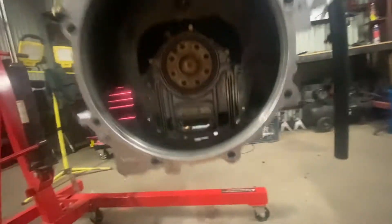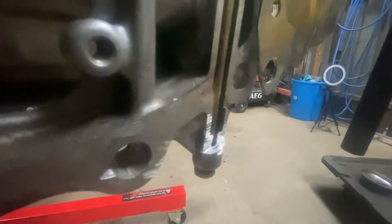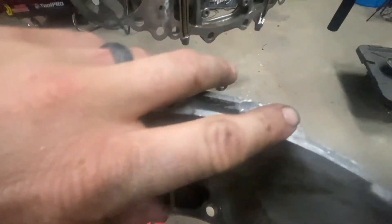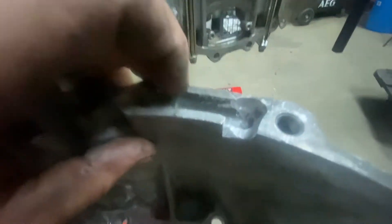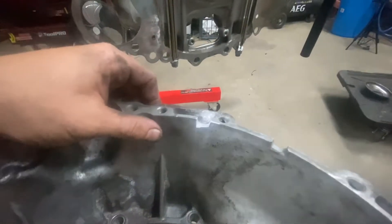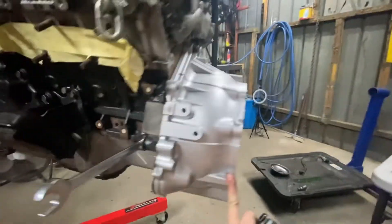I've test fit the bell housing and you'll notice there is a minor obstruction where these long bolts from the original 380 sump hit the bell housing. I've used a fine liner to mark that position. I'll trim that bolt and grind the bell housing a bit in that location. We've just made some minor adjustments — ground out just a little bit. I marked that and then just cut across. On the other side to clear this part, I just used a Dremel and some grinding stones and cut it away. That'll actually be completely out of sight when this is on. So we can bolt it up.